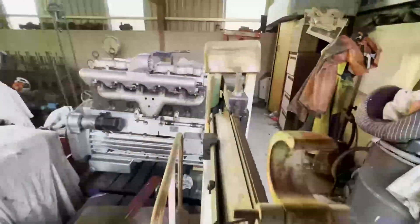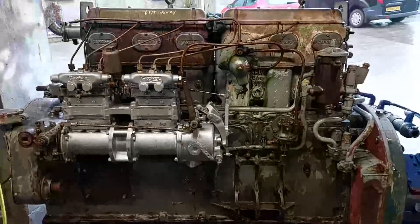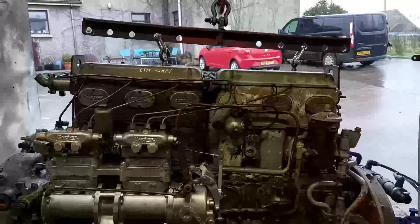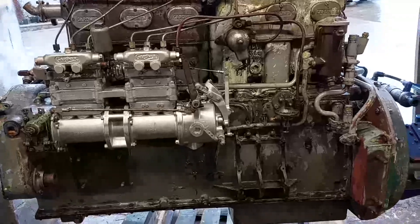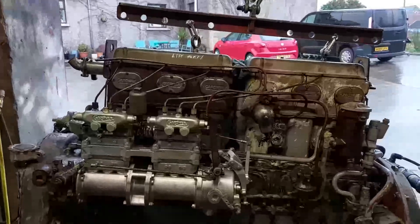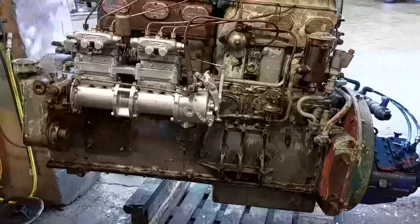This one is really quite heavy - it's 14 kilos, which is quite heavy when you're trying to operate it single-handed. This is a 6LW - quite a heavy engine because it's a cast iron crankcase. You'll see I've lifted it in the suggested way and it's hanging quite level, despite the fact that it's got a gearbox.